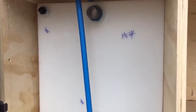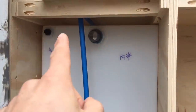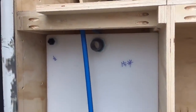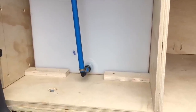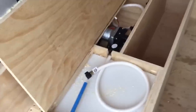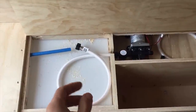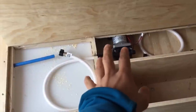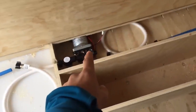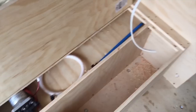I have most of my plumbing done. This is our tank — a 32-gallon tank just behind our left wheel well. We have our vent inlet — that's how water goes in — and this is going to connect to a remote fill door. Down here we have our outlet — the cold water coming in — which fires its way through above the tank towards our pump. This is a silencer kit: basically pressure-resistant flexible tubing that allows the pump to wiggle and shake as it moves without rattling and causing vibration in amongst the solid pipe.